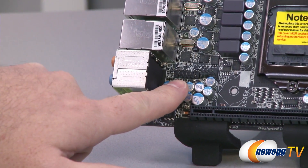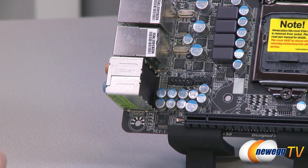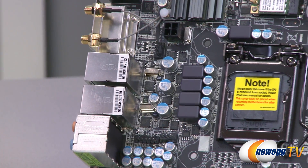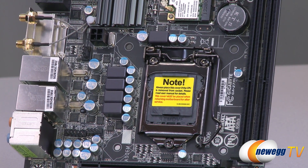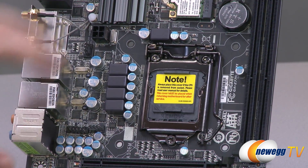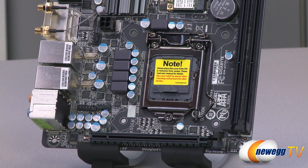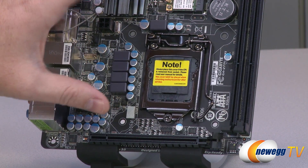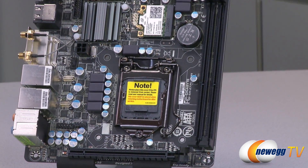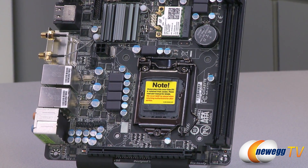Right here you have your front panel audio connectors. Audio is on the right, and you can also get a little two-pin S/PDIF header there as well. Above that and to the right is the CPU socket — 1155 socket for Sandy Bridge or Ivy Bridge processors. You can see the power delivery around it. In this situation, I'd actually recommend a downward-firing CPU heatsink fan to provide a little extra airflow over those components, because due to size limitations there are no heatsinks on the power delivery.